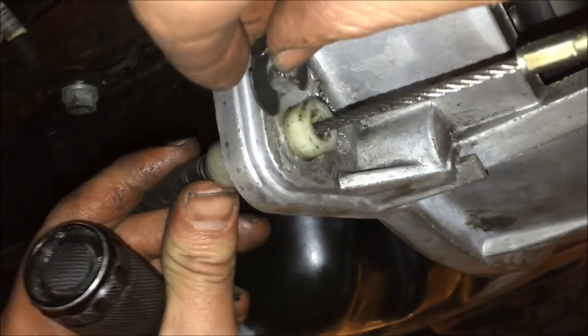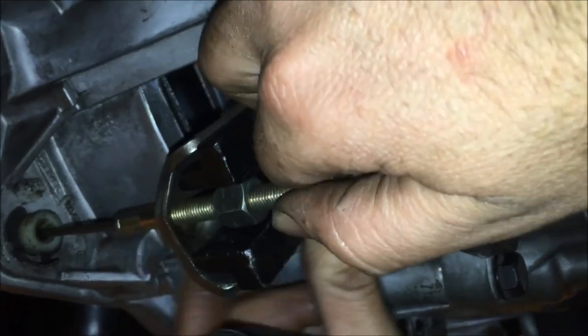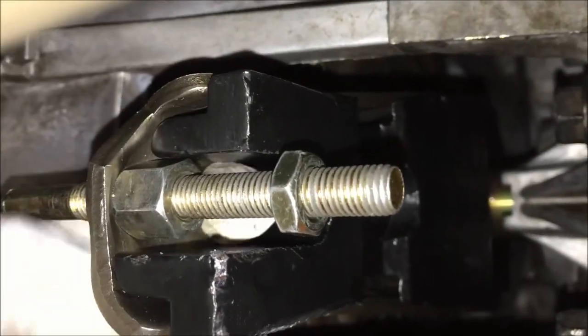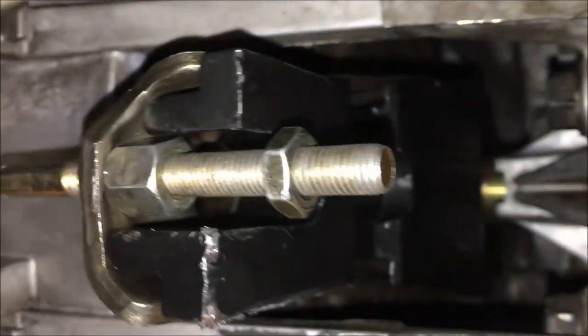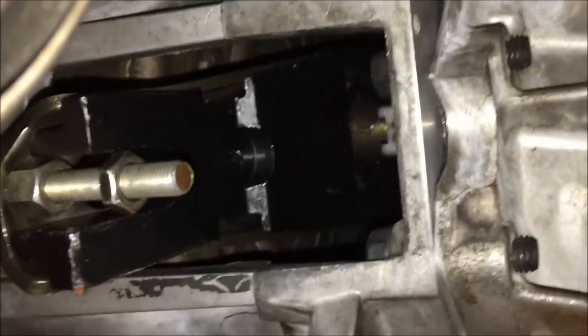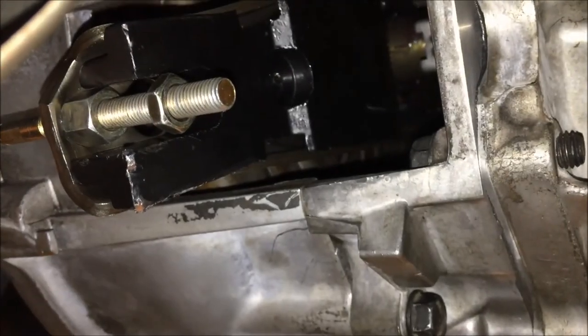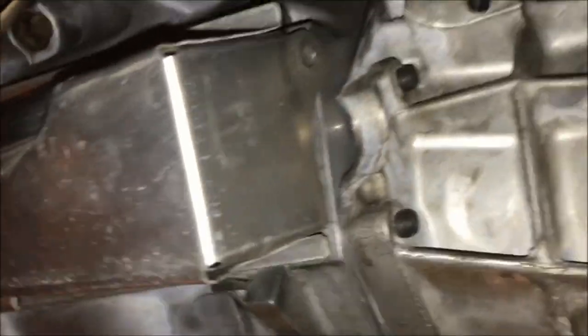Run your clutch cable back through the transmission, put on your C-clip to hold it in place, and make sure the clutch cable is going through your clutch fork. With your clutch cable looped back through and locked into its place, we still have a jam nut here because this is an aftermarket cable. We're actually going to leave this cover off as we drive the car around to adjust it, but to show the process: the dust cover just slides over and goes back into that little channel, and at the top there's a 3/8 inch screw that holds the dust shield in place.